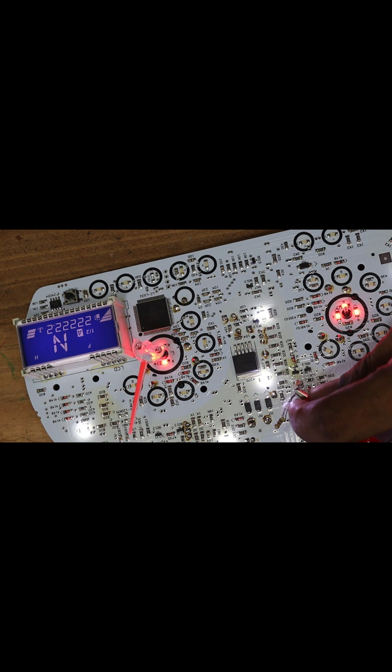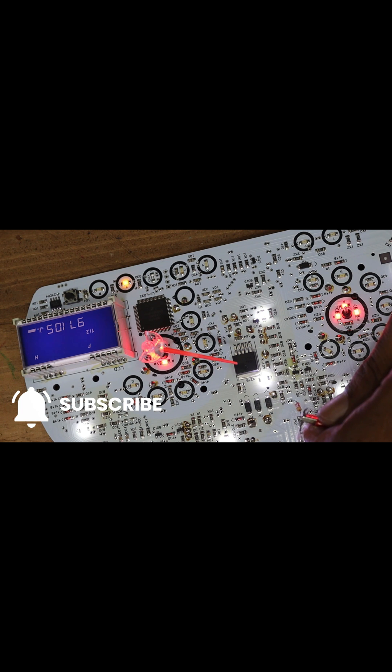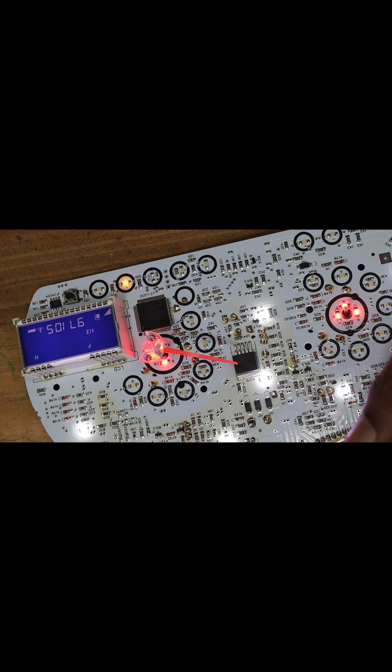Now let's see what happens when the engine is on. When the engine starts, the speedometer sends a signal to this pin, causing the meter details to change like this. You can observe that it functions correctly when I manually provide a signal to the base pin of the transistor. However, our issue is still not resolved.